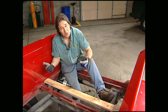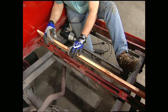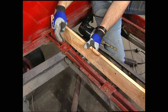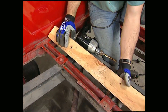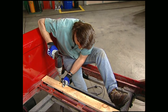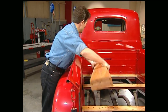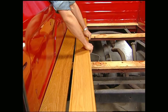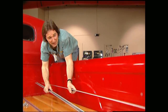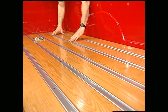We need to raise the bed to get clearance on the sides here. First thing you need to do is measure your support, then cut a board about an inch thick to lay down on top of there. You can see I've drilled a hole for clearance for my frame bolt, and I've also marked my holes for the mounting bolts. Make sure you use sealer on these boards too. Once you have at least three coats on your boards, they're ready to go in. This is the easiest part of the whole project, thanks to the precision cut you get with Bruce Horky's kit. Once you have your boards in, slide in your strips, position everything how you want it, and all that's left is to bolt them down.